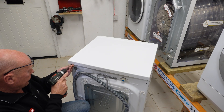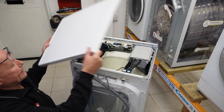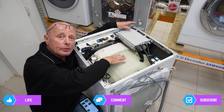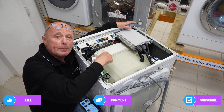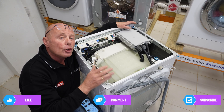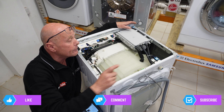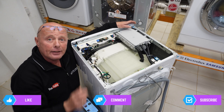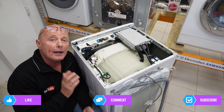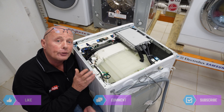Let's take the lid off. Before we put it onto the workbench, tap it backwards and it will come away. LG — big thumbs up here. You've got a drum in the machine where you can change the bearings; this drum is splittable, meaning customers can choose to change the bearings at a later stage in life if they wish to. Too many manufacturers are building sealed drums with built-in obsolescence. The second thing I love: you'll notice that all the components here have part numbers on them, meaning you can go to our website, enter a part number, and find the correct component for your machine rather than making it overly complicated like a lot of manufacturers have done.